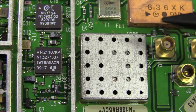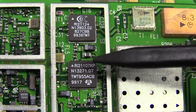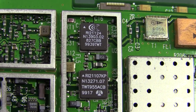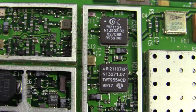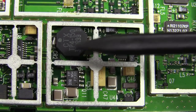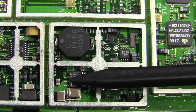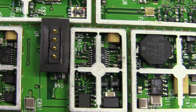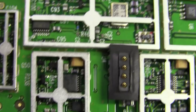This RF amp here is sharing the same can — clearly driving the satellite phone output. That's a Rockwell chipset; can't find any data on it at first glance. Interestingly it's dated week 17 of 1999. This is supposed to be a 2005 vintage phone but it's using Rockwell chips dated 1999 — so this thing was definitely manufactured in '99. We've also got a Qualcomm GUM2000 CD90, and some Maxim and TI action. There's also a can-within-a-can arrangement, and there's the main TCXO. Quite a lot of blocks under here — unbelievable.